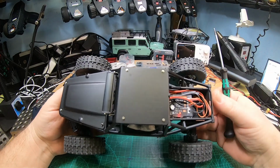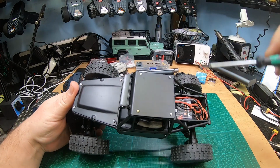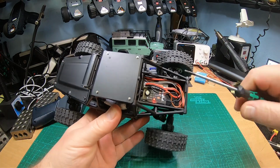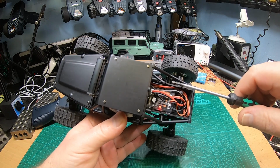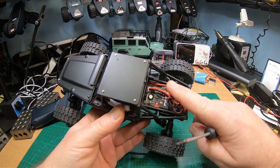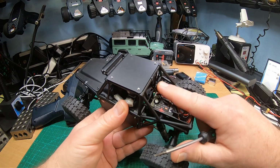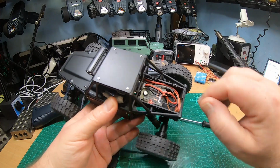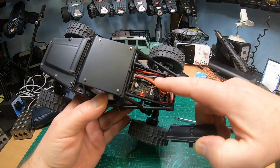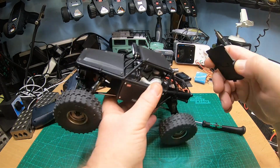I moved the electronics and battery electronics, which initially were here, to the battery compartment, and the positive surprise was that I needed only one single extension for the servo, and all the other wires and plugs fit in here. I mounted it only with double-sided 3M tape to the side, and even the plugs fit, and you can close the, what's that, cap, bonnet, and yeah, no wire mess, nothing. This worked so awesome, a super big surprise.